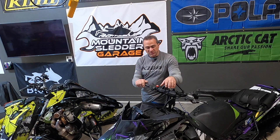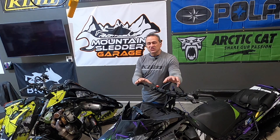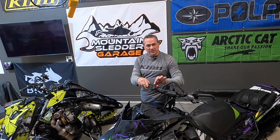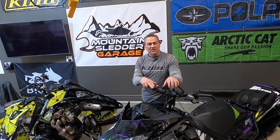I'll give you a few examples I've had over the years with the throttle safety switch being a problem. The throttle safety switch has been a big problem on Arctic Cat for the last few years — not working or breaking while you're out riding. I was out riding this last year and we stopped after three or four hours and went to start again — it would not start at all. We pulled it apart, looked at everything, couldn't figure it out. Sat and ate lunch, went back, pulled the rope and it started right up. So the throttle safety switch can be very finicky. You can get water in it or ice in it — make sure the throttle block is always cleaned out, as ice in there can cause throttle safety switch problems.